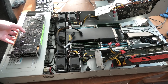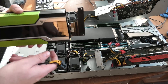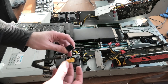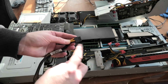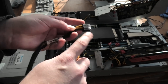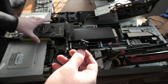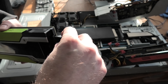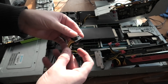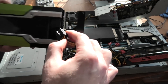I found out in my last video that I didn't have the right power connector for my servers. This graphics card is a server graphics card and it uses an 8-pin connection, but not a normal 8-pin connection. This cable goes from one standard to the other. On the regular 8-pin connection there are three yellow wire connections and one black, whereas on the other one there are four yellow connections. This is a 150-watt connection whereas this one is a 300-watt connection, and they use thicker cables.